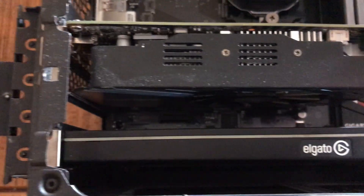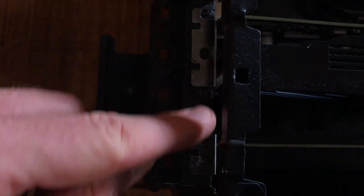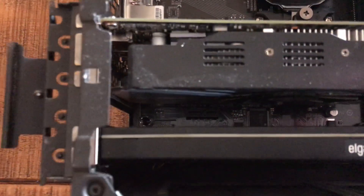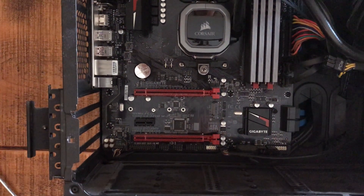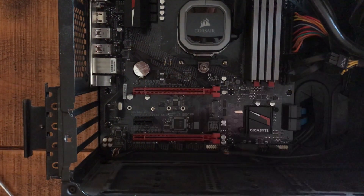This is where my card is going to go in — just there. Obviously, the next how-to video should be how to clean your PC properly. You normally have, on the back here — you can see these here — you'll have to take your current one, you have a little shield in there, bring that off with a screwdriver, and then input it into here. So as you can now see, I've taken out the graphics card and the capture card just to give you a better angle. The graphics card was here, capture card was down here — this is where I'm aiming for the wireless card.